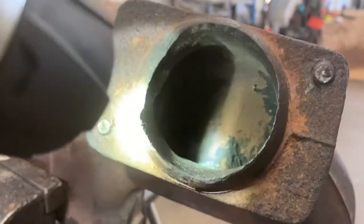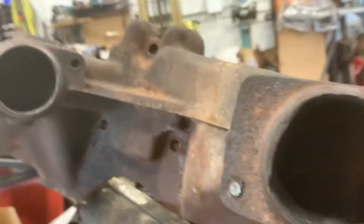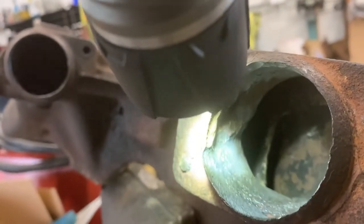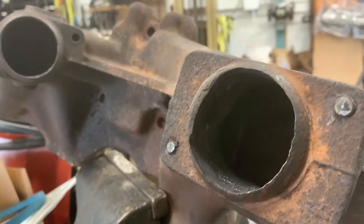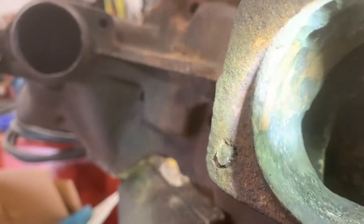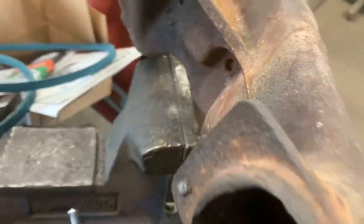You can see there's this one section I haven't done yet, but it's gross — I don't know what the purpose of that was. And this plateau way in there — I flattened it up quite a bit. If you look at how much metal is gone, that's a big difference. It should improve the flow quite a bit. I just don't want to blow through the back in here where my finger is — you don't want anything poking through there because then you're going to leak.